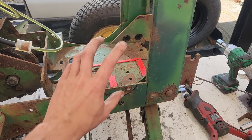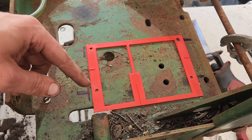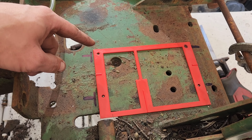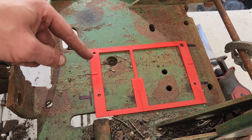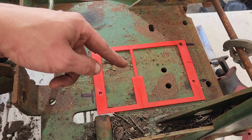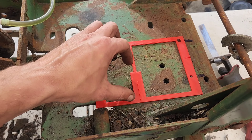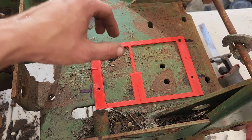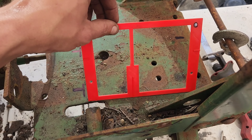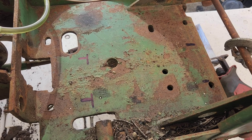It looks like the plasma cutter and I are going to have to cut out a slot for the centrifugal clutch to be able to slide on and off when we need to. We've got our 3D-printed template that I designed, which is over on Cults3D — I'll post a link below. I charge a buck to download the STL file. It's got the oil drain ports marked, where to drill marked, and the shaft marked exactly where it should be. It's the standard length for a Predator or a GX200, so if you're trying to figure out where the shaft goes, you just flip it over to see how the shaft lines up.